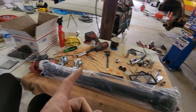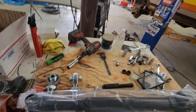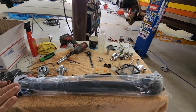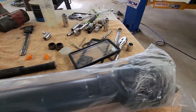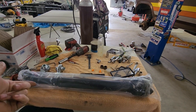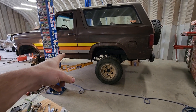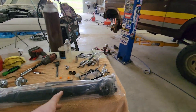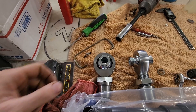Here's a little sneak peek. I rebuilt the drive shaft in the last episode for this truck, which was like a $100 rebuild kit off Jeff's Bronco Graveyard. I felt like it was high, and then I stumbled upon the internet one day — this was $200 brand new. So that's U-joints, the double cardan, the slip joint, everything new. I'm really kicking myself that I didn't find that earlier. But the rear drive shaft is also the front drive shaft, so I'm just going to put the rear one that I rebuilt in the front and put this new one in the rear. If the front ever gives me problems, it's $200.